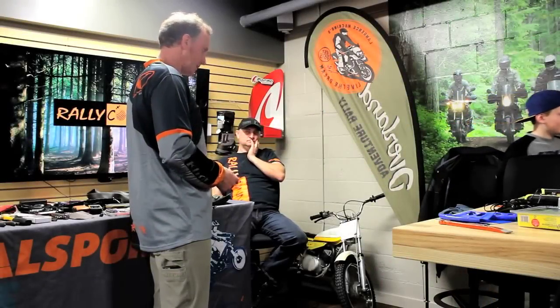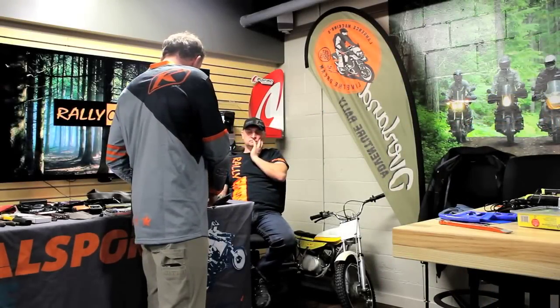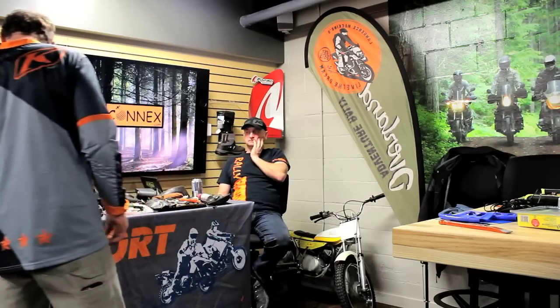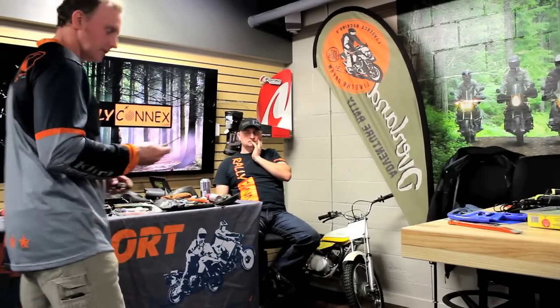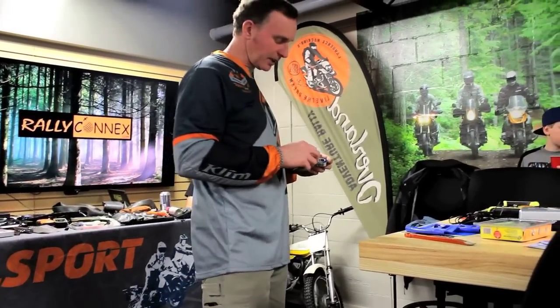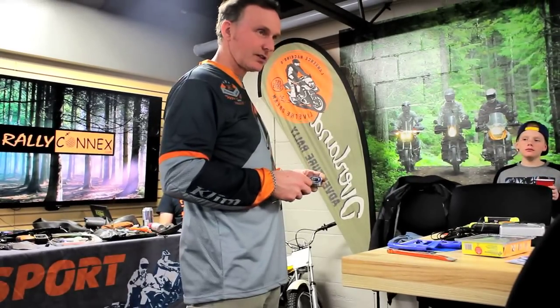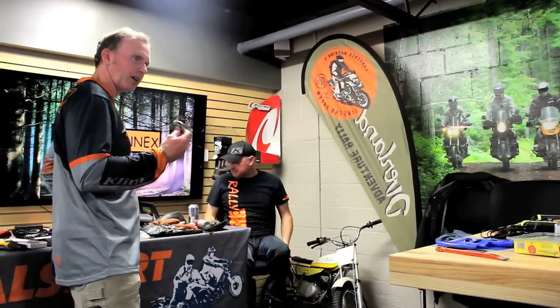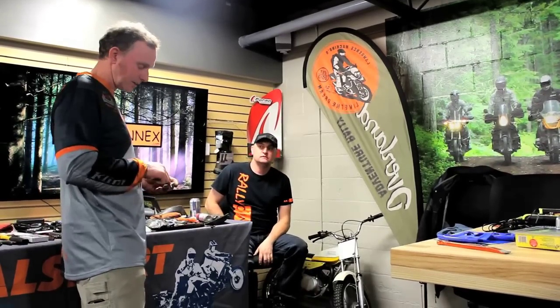This is handy for bearings. We've had bearings dry right up. If you carry a little pick with you, you can actually pull a seal, trail side. If you had a little squeeze of grease, you could put grease into that and keep going. Even though that bearing dried right up and it was squealing for the last 3 miles, you can get out of there if you take some time, pop the seal off it, get something in there, anything.